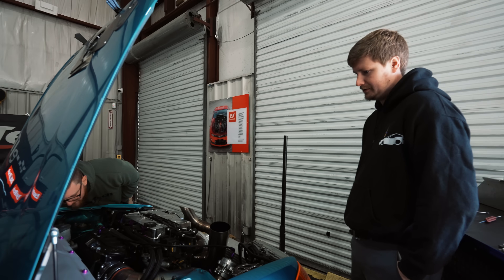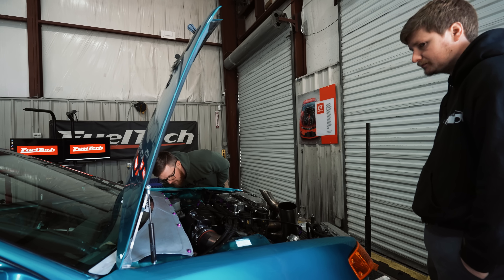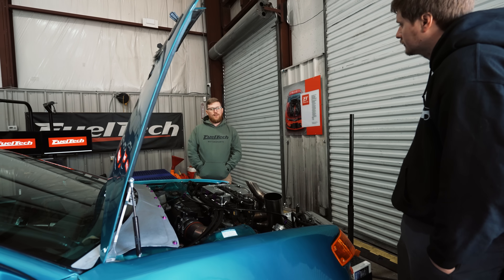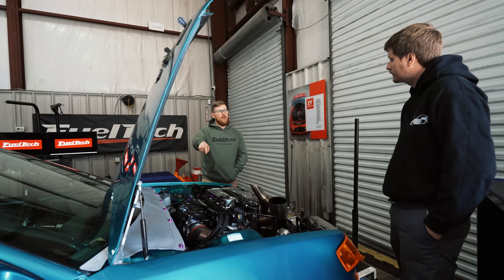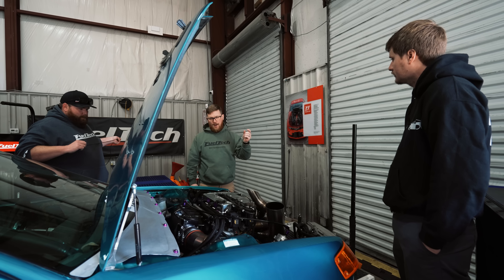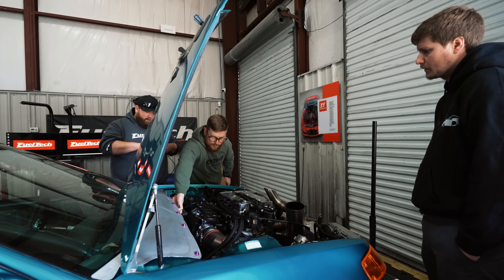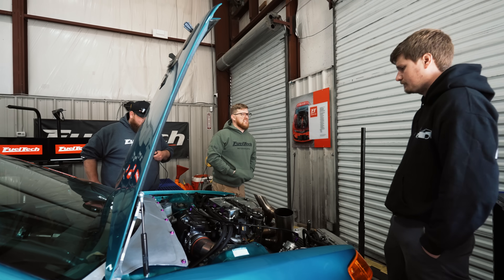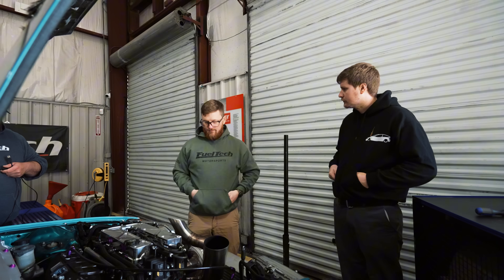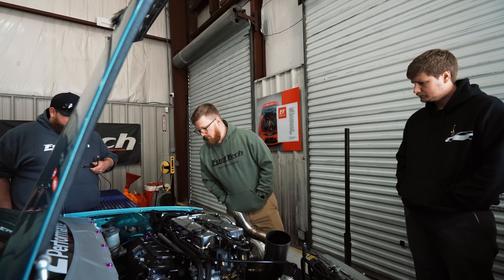One of the most convenient things to work on in this little engine bay. Later on, I would advise putting it on a whip with a hose, because I think that's eventually gonna vibrate off — it's like fitting with a fitting with a fitting. You can still keep that number three or four, and just put a little mount there and run like a six-inch hose or something, whatever is enough to keep it from pulling on it. That might help at least with vibration.